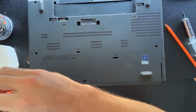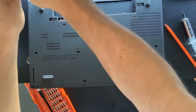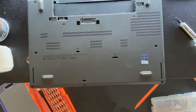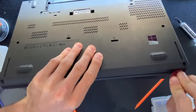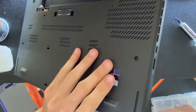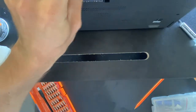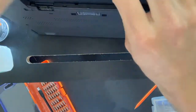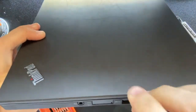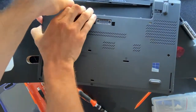The very first thing in this process is getting a Phillips screwdriver. On the back of the ThinkPad there are seven Phillips screws, one of which is hidden behind the removable battery up top. Once you remove the seven Phillips screws — you don't fully take them out because they stay seated due to retainers — you just need to fully loosen them, then go around the edges of the back case with a pry tool like a guitar pick or a spudger.